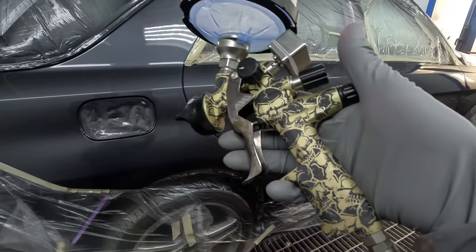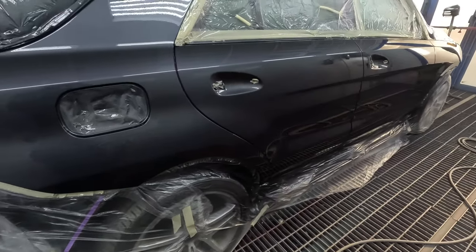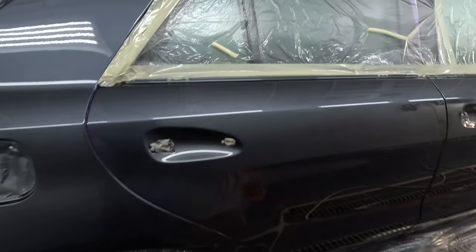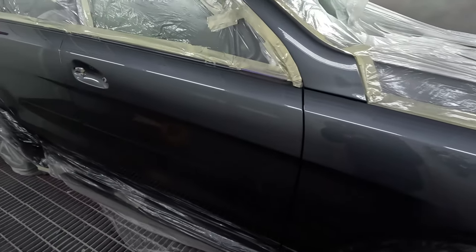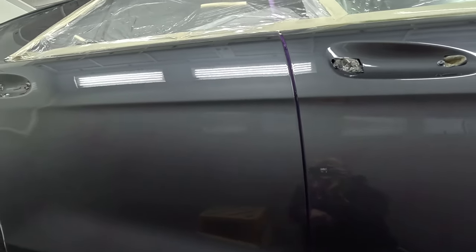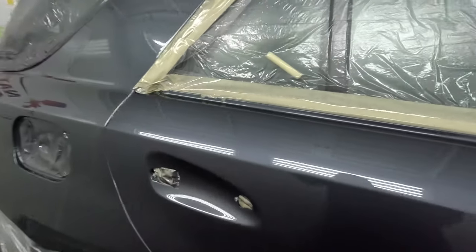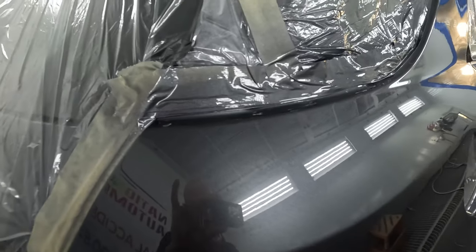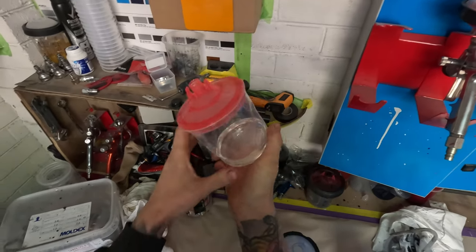The low-energy clear I've got now — half an hour and you don't even have to leave it on spray cycle; go in and unmask it. It is a little bittersweet because I do love this Performance Pro clear coat. It's worth mentioning they actually recommend this clear gets baked even if it's the last job of the day. This is the next morning after a bake and you can see it's got awesome gloss retention, even where all the base coat is.